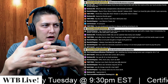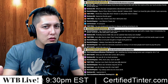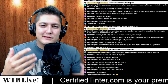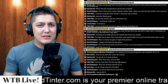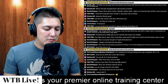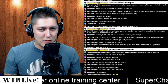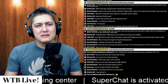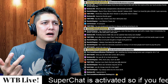Think of a rubber band. It's pliable and it's stretchy, right? But if you leave that same rubber band in the sun for long enough, when you grab that rubber band and you pull it, it'll just pull and fall apart. Same thing with window tint. After about 7 years, it's just going to get brittle on you. And when that happens, unfortunately, the only way to remove that is to get a scraper blade and start scraping. And that's the worst. That's probably my nightmare of this industry. I hate doing that because it's messy, it's hot, it takes a long time.